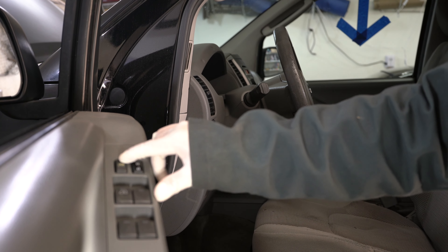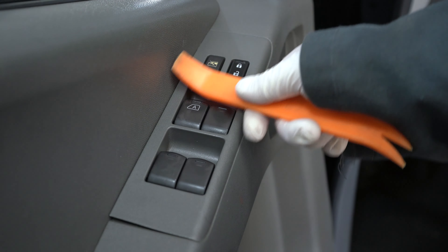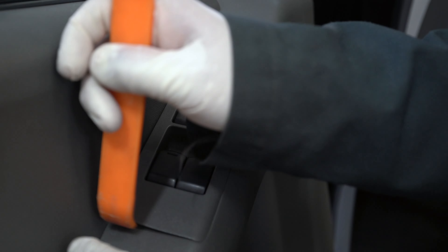It rolls right back up. So sometimes if the passenger window doesn't work, the quick fix is just go ahead and jam this unlock button up and down really quick. Now if you want a better fix for these window controls right here, we'll have to pull out this control panel and clean the contacts. All you got to do is use a trim tool and pop it out.